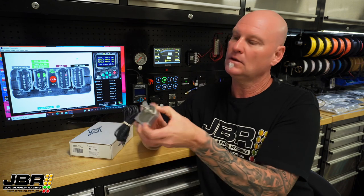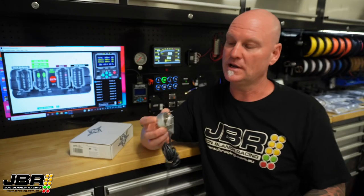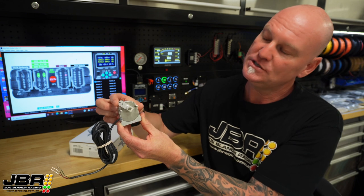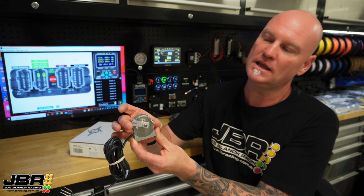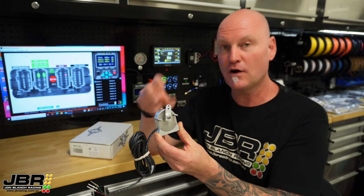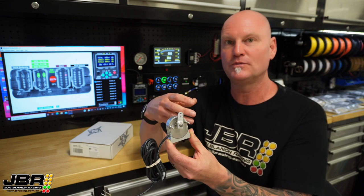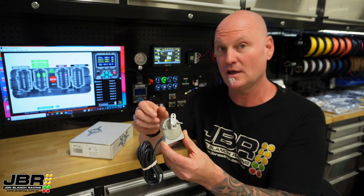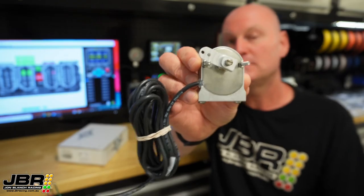To get it to work, you're going to need to fit one of these sensors to the side of your transmission. As you cycle through each gear, this is connected to the linkage on the side of the gearbox, and for each different gear position it sends a different voltage signal to the dash. We can then program the dash to recognise what each voltage means and convert that into a gear display or gear position for the automatic transmission. This sensor I have here is made by Dakota Digital.